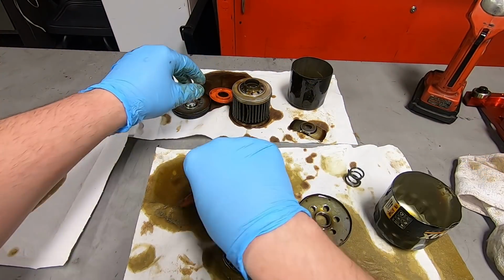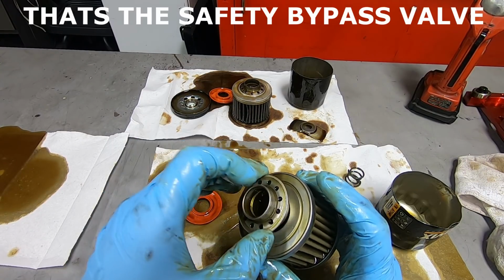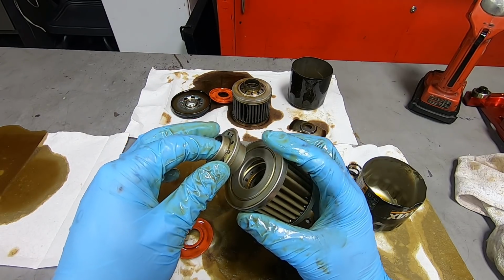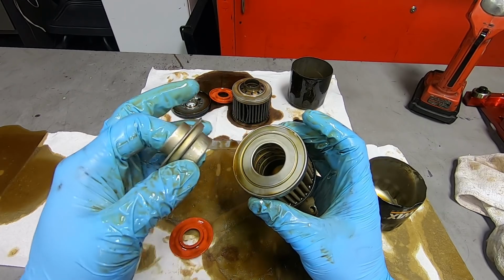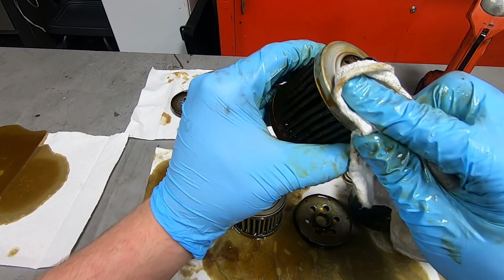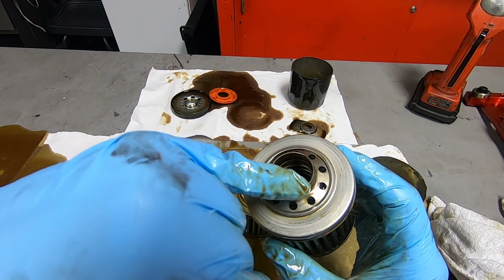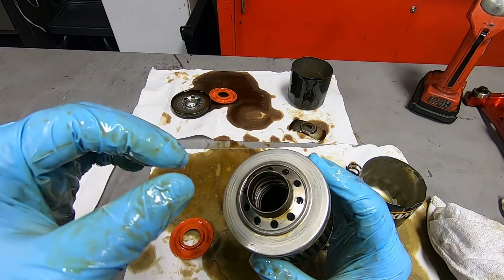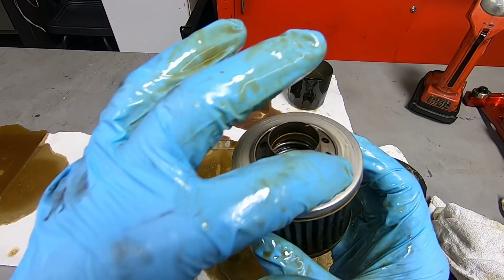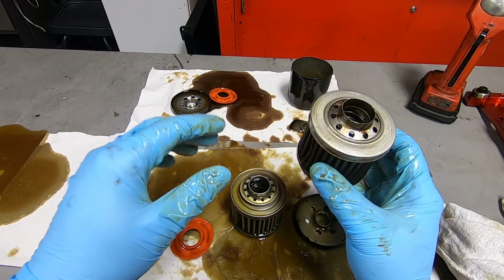That's interesting. I just noticed that this top part didn't have a real type of seal. It's a pretty tight fit, but there isn't much of a seal right there, which is interesting. So oil could presumably pass from this side to the filtered area side, whereas the Harley-Davidson one is very positively stamped, where this top plate, this inner steel piece and this outer steel piece were two different pieces. Then this inner part was set down inside, and then a press or some sort of rolling mechanism rolled over this edge here. So it has a very positive, affixed dimension to it.